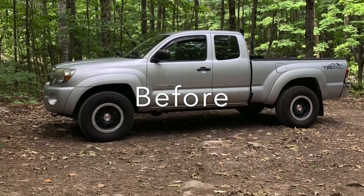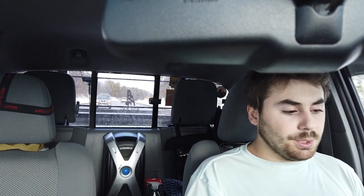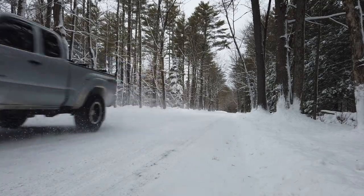That setup leveled out the truck, so it no longer has the factory rake. It looks really good aesthetically and it doesn't really mess with your CVs or tie rods. You don't even have to upgrade your upper control arms unless you go over two and a half inches, which I wasn't planning on doing. I have a little over 1,500 to maybe 2,000 miles on them. They really shine at around 35 to 40 miles an hour — that's when you feel the biggest difference. At lower speeds I wish they were a bit more dampened, but I paid just under $600, so beggars can't be choosers.